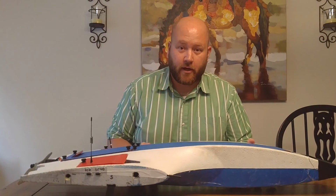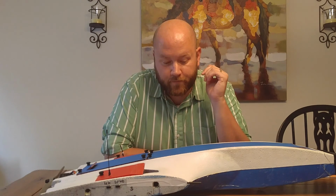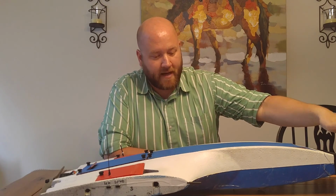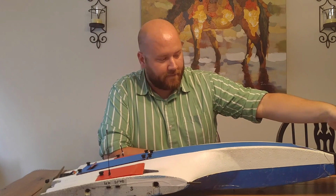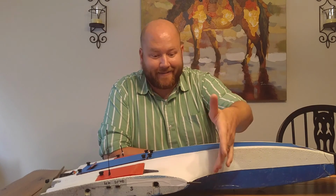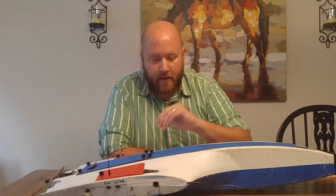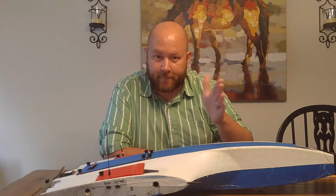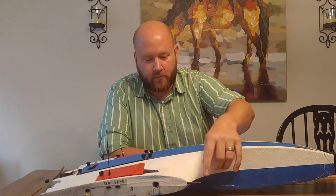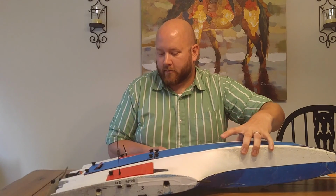Ideally, you want to have it on the nose or somewhere where there's as little aerodynamic influence. You don't want to mount it far back, and if you have a tractor, you don't want the wind from that hitting your airspeed sensor. Obviously, it's going to throw things off. So get it out of the airflow as much as possible. Having it hit the air first is the ideal scenario. On this plane, this sticks out plenty far enough, so it gets an accurate reading.